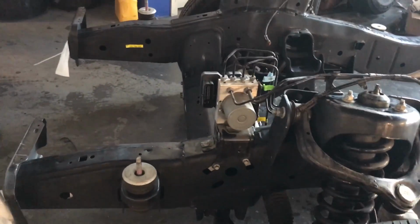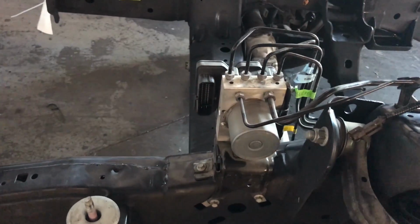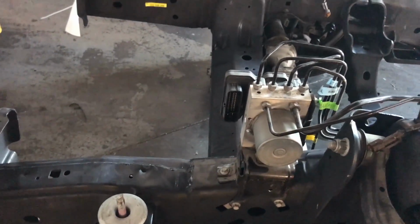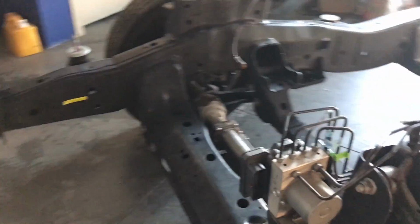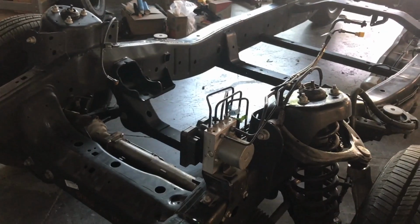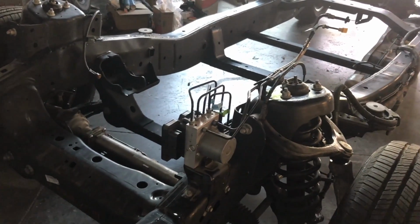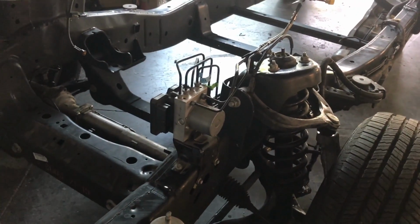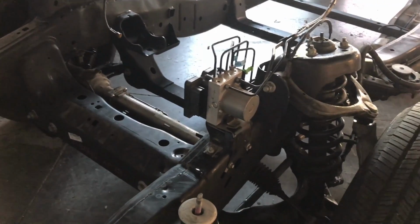Make sure before you remove it, you see the angle where it's located. It's kind of like a 0 degree or a 90 degree compared to the frame, right? Because you want to make sure that you put those the same way with the suspension on the bottom. The suspension has to be released, not too high and not too low. So kind of like the way right now, this is where you want to tie the suspension up on the bottom part, right? And then the reverse order to install.